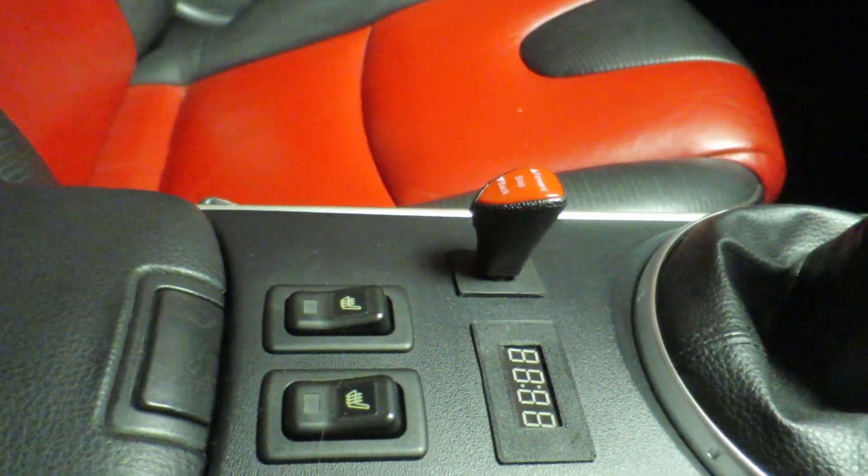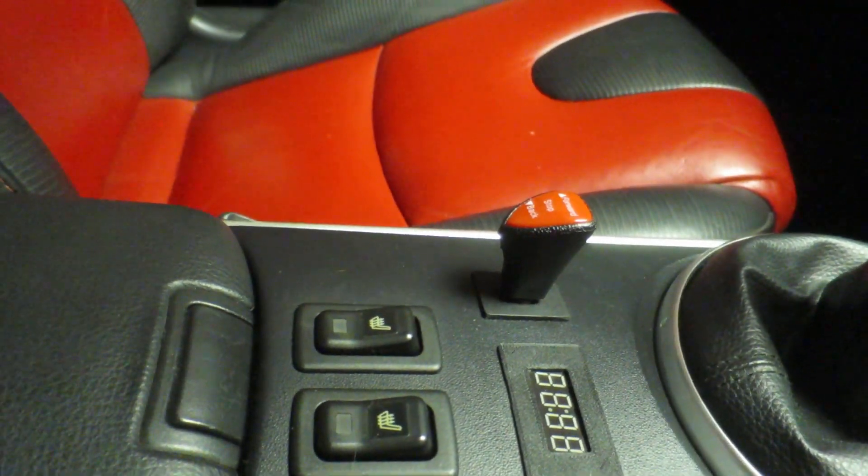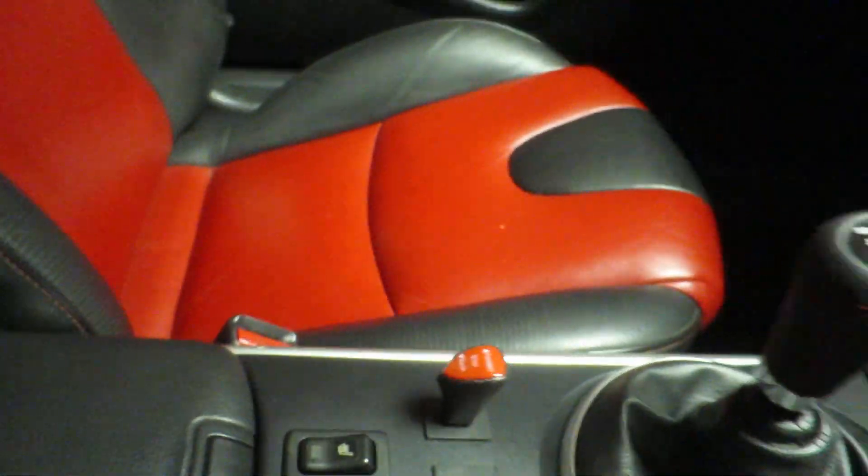In the cockpit, I'm going to make the little toggle switch work — it used to work in version one but it doesn't in this one. It's basically going to be a failsafe. I need more failsafes; when you drive it you start to realise that. Obviously you can just turn the ignition off and it'll die, but then you lose power steering and everything. So the toggle will let you kill the motor while keeping the car alive — brakes, power steering etc. That's a safety feature I think is actually necessary.